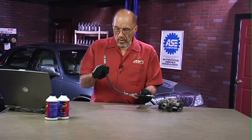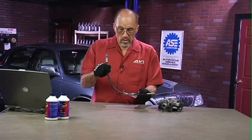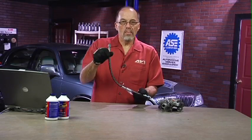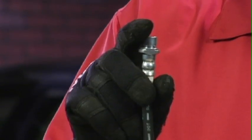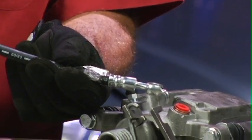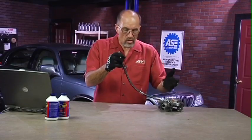As I replace this type of hose, what I'm going to do is mount this end first and then mount this end on the caliper. I'll probably bolt it in here because I want to make sure that it fits nicely without any kinks or anything else.